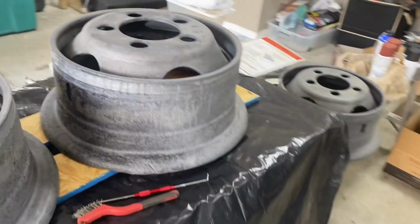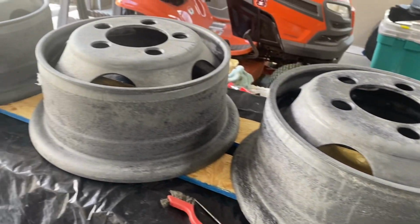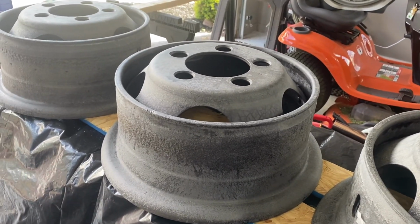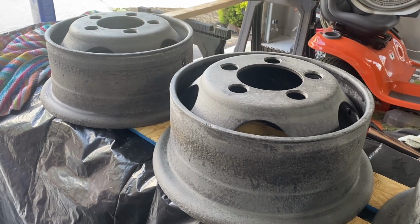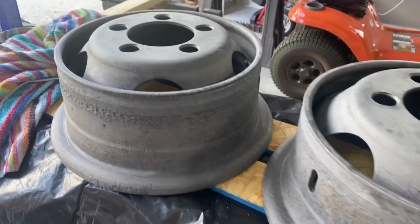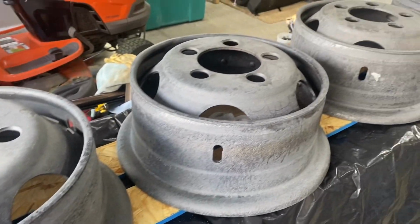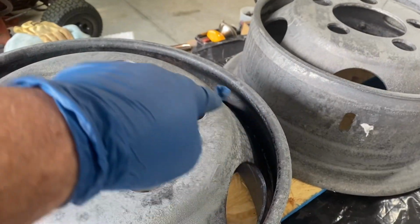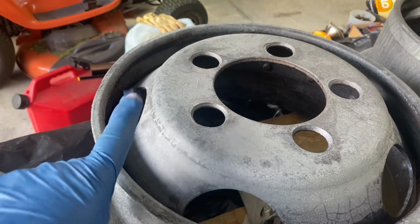What did I do? Let me turn the camera around. So the first thing I did was I took these rims and locking rings to the blaster, and I had them blasted, and they did a really good job on getting all the rust out of there. But just as extra insurance, I went ahead and sprayed all these rims with Ospho, and that is a great treatment to put on here because it'll get into all the nooks and crannies and soak into the metal and basically convert any rust that you can't see